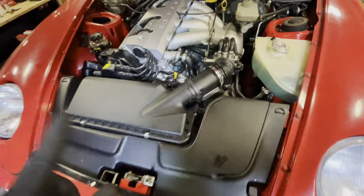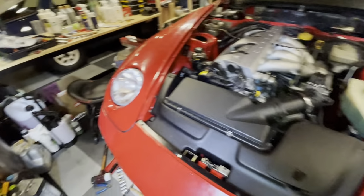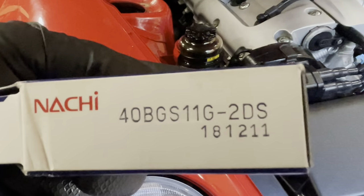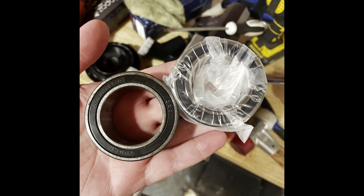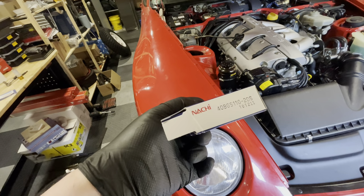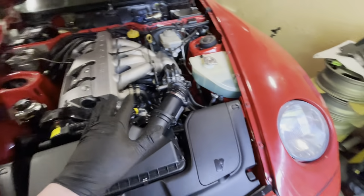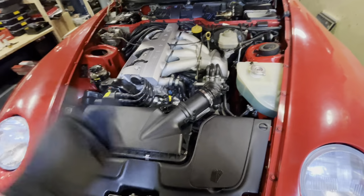For those of you that don't follow me on Instagram, I managed to find a bearing for the aircon pulley and I've got the box on the bench over here. This is the part that you want to order, 4TBGS11G2DS from Nachi. This is exactly the same bearing as I took out. This was, I think, 56 euro. So that's a lot cheaper than buying a reconditioned pump, which is about 450, or buying a new clutch pack, which is 900. So that's all done.